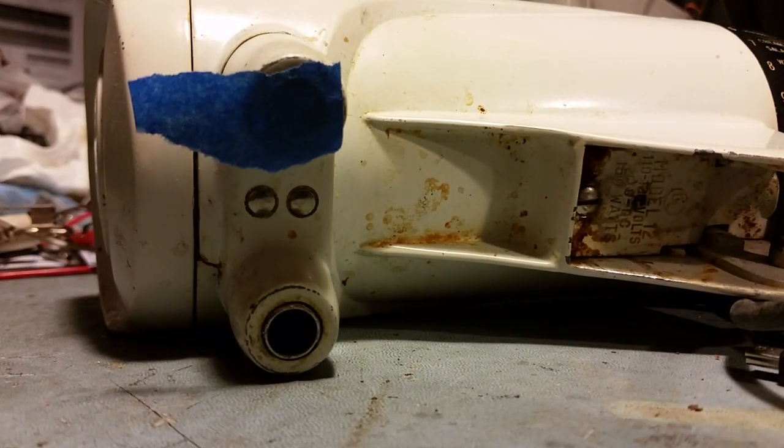With the help of Dave's Repair.com, I found out that the low RPM adjustment on this thing — position one, right here — there's an adjustment for it. Once you get that adjustment right, the rest of the range takes care of itself. That's how I did it.